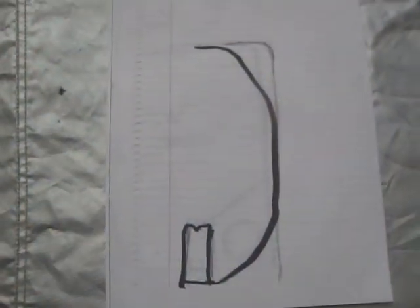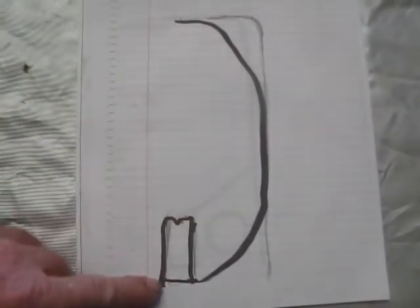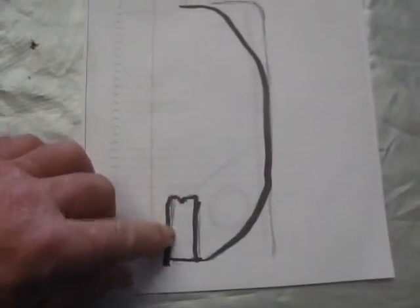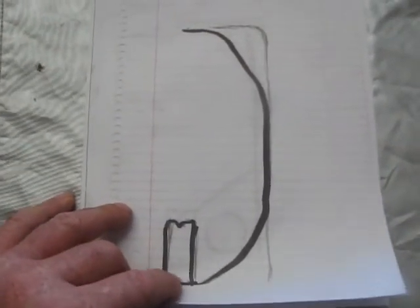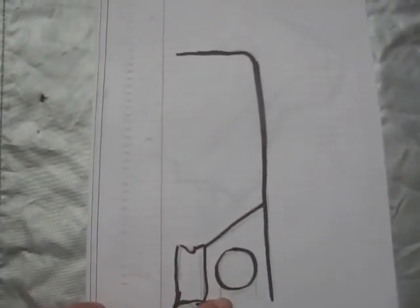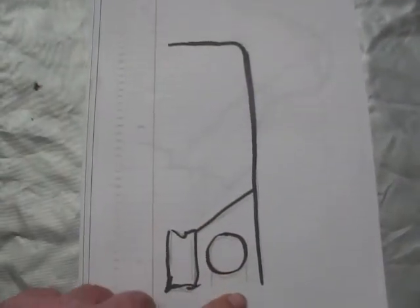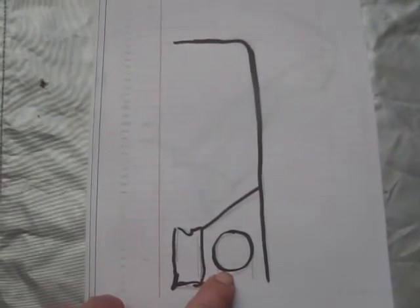Part of the design considerations for the body of this car: this is roughly the shape of the original door panel in cross-section, with this right here being the chassis or the frame. The finished car is going to be more like this — out and down — to give us a straight side. I already have molds that give me side panels like this from doing the dirt race car, and this will be where we'll run the exhaust.